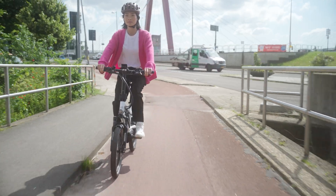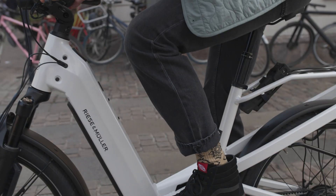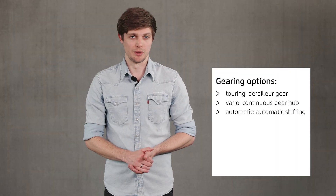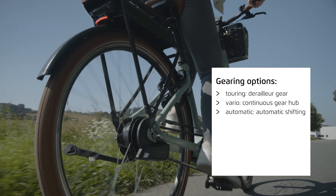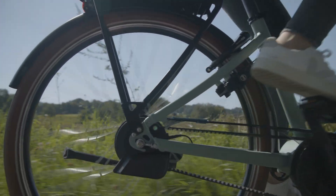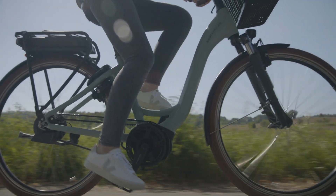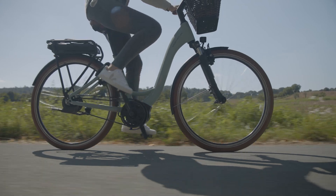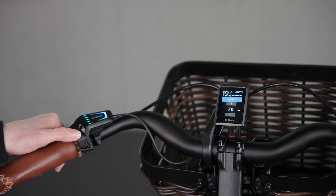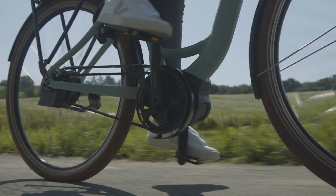The assisted 45 km/h for S-Pedelecs is also harder to reach with the Vario. The Vario can be used for a wide range of applications, but this type of gear is best for urban use — short distances and many stops. The automatic gearing system, the Enviolo Automatic, offers even more comfort. It is similar to the Vario version but shifts gears automatically, whether on a slope, on a flat road, or at traffic lights. The automatic offers the greatest freedom among the transmissions. Choose your optimum pedaling rate once and never think about it again. If necessary, the cadence can also be adjusted on the display at short notice. The advantages of the Automatic are also best realized in urban areas.